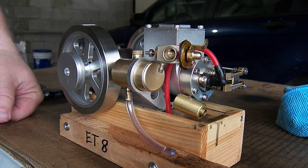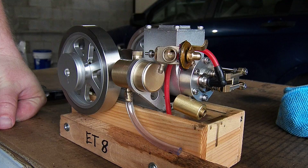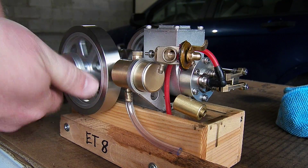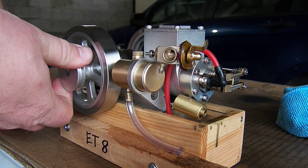Alright, we'll leave that where it is and we'll see if it runs next time. I will remember that I need to probably just shoot some fuel down the intake to prime it, because I need it to suck a bit more fuel before it warms up. But, excited that it ran after I cleaned the carburetor again, and hopefully that means the carb is going to stay clean.